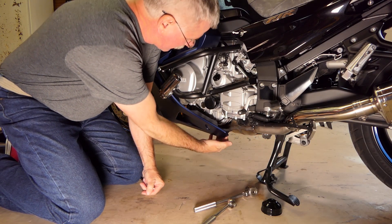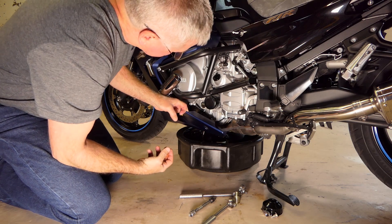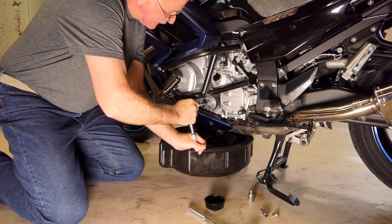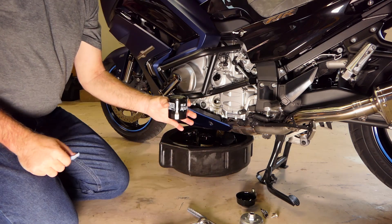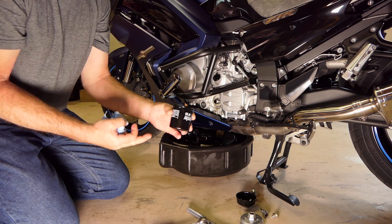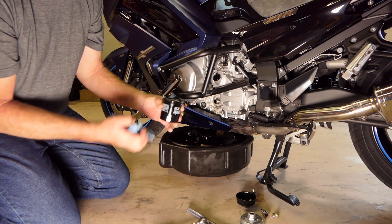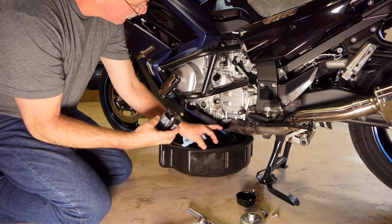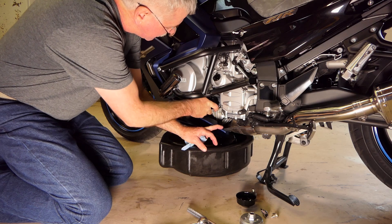I can pull that back and the oil won't run down inside the fairing. Pretty clean looking oil. I like to pre-fill my oil filters. I've got this one about half full after it's sat a little bit. I can't fill it all the way up or it'll dump out when I go to put it on, but half full I can get it on there without making much of a mess. At least it'll be half full of oil when I start the motor, so it won't take as long for the oil pressure to come up. If you're quick about it, you won't lose much, if any.